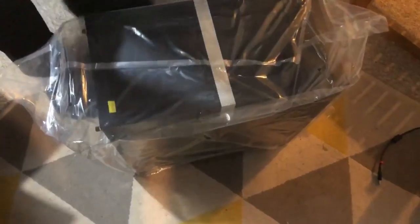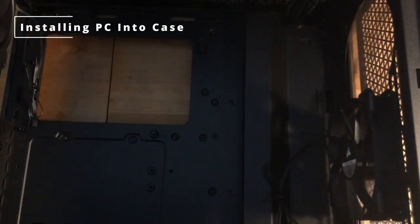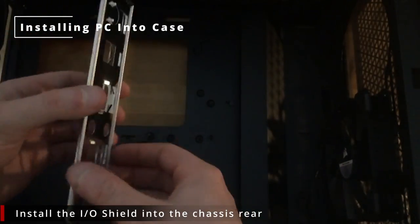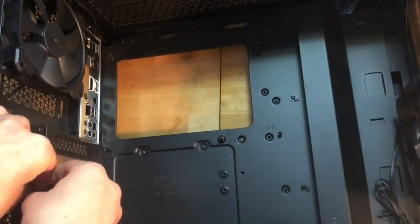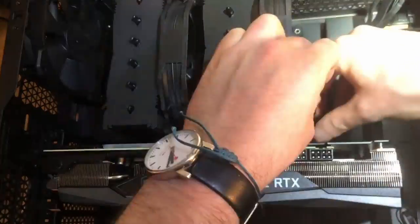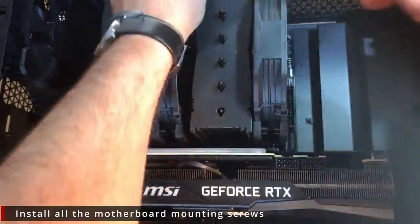Make sure you save and exit and we're now ready to put the build inside the case. Unpack your case — be careful if you have glass panels like this one not to break them. Lay it flat and take off the access panel, moving the cables out of the way so that when we put the PC down it goes in smoothly. We're now going to install the IO shield on the back of the chassis — make sure you get the correct orientation and firmly push it until it clicks in place. Remove the unneeded expansion slot covers so that your GPU can be inserted, then drop your build in so it lines up with the screws and slots. There's a pin in the middle to locate it — go around and fix all the screws in place. This can be quite fiddly and take some time, so just be careful.